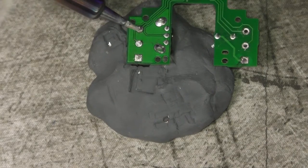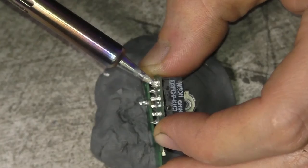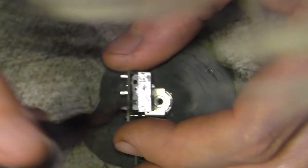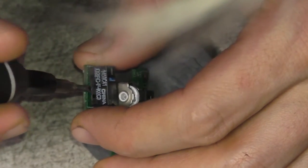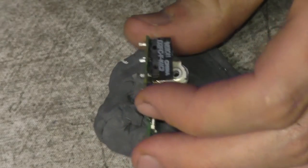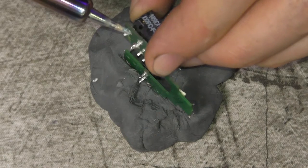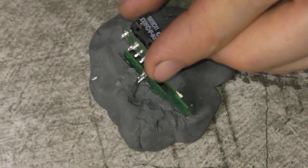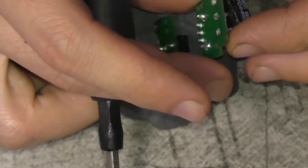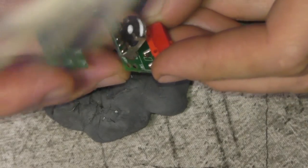You can see I was just turning it to liquid and then sucking it up. What you want to do is go around and put the soldering iron on the tip of each pin until the solder gets soft — you can see the pins start wiggling. Then put a small flathead screwdriver between the switch and the board and gently pry it off. It helps if you're quick or even have two people — one holding the iron on the pin and one with the screwdriver. It looks easy in the edited video but it actually takes forever.